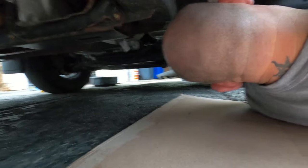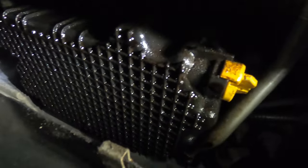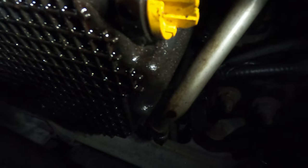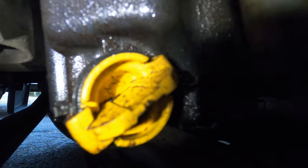Now I'll show you where the oil drain plug is. The replacement Dorman ones are orange; this original one is yellow. You can see everything is wet down here — I've been noticing a little oil drip in the driveway and it's definitely this leaking drain plug. The plug doesn't have a half-inch ratchet inset, so grab it with a pair of pliers; you can see the clips on either side and it'll just pop off.